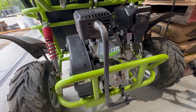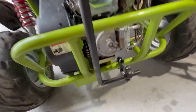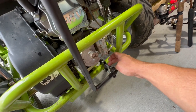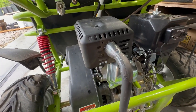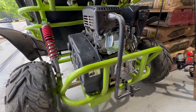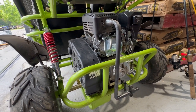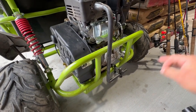For bending the pipe without a pipe bender, you fill it with sand, pack it in really well, then bend it with pliers or a vice. I can't believe how much quieter this made it — it's actually so quiet you can barely hear the exhaust anymore; all you hear is the valve ticking and the engine mechanicals. Most of the hardware here came right off the pallet the go-kart was shipped on — the nuts, clamps, everything. I only had to buy the pipe and the three-quarter inch NPT barbed fitting. It didn't rob any power; it actually feels like it has more low-end torque, and it completely eliminated the backfire popping when you let off the gas.